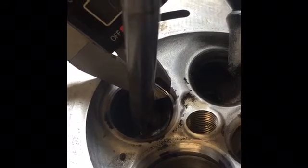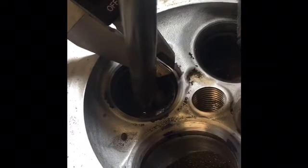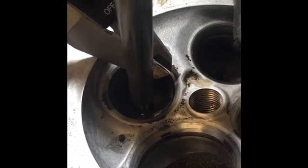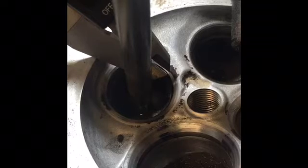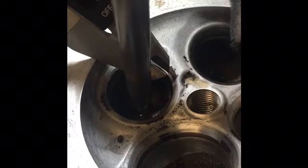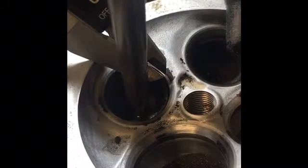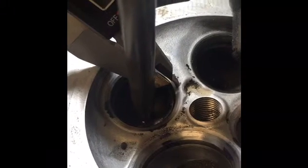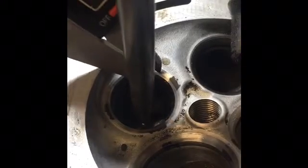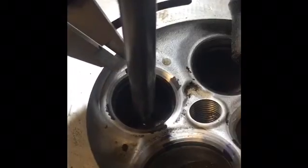thickness, which is what we want, but we have to be careful with how much material we take off of the 60-degree, because we can very easily make it too narrow so that it no longer is wider than 55 thousandths of an inch, and that means that we'd have to go back and just kiss our 45-degree to bring it back within specifications. So let's go ahead and do the 60 and see how we do. Once again, paint the surfaces so that we can see exactly how much material we're taking off of them. Just makes it a lot more vivid.